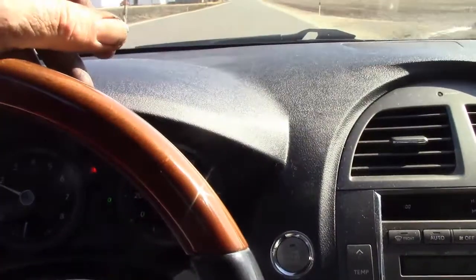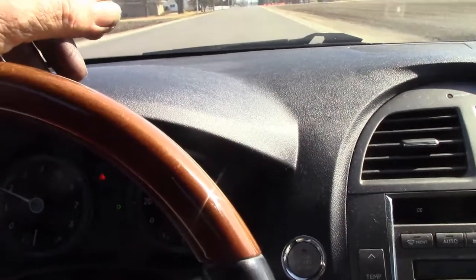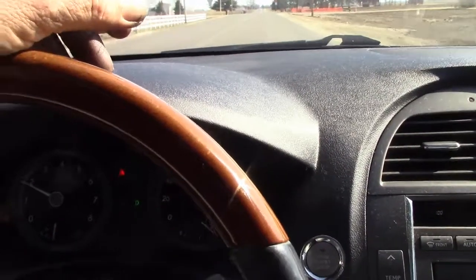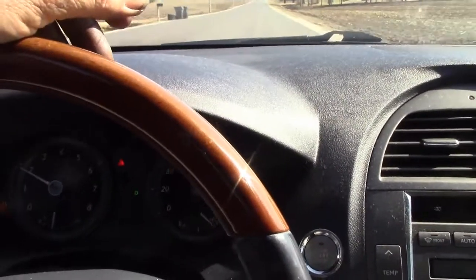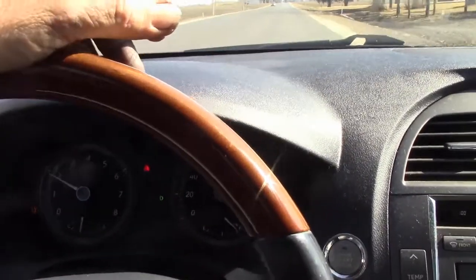We're doing all those things right now in the first half of the test drive without actually using the brakes very much. And then I'll check the temperature of them. And on the way back, then I'll use the brakes a little more aggressively and just make sure that everything's okay there. And if everything looks okay, at that point we can consider this job done.